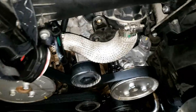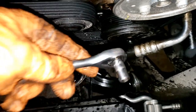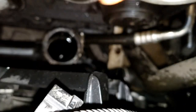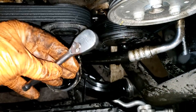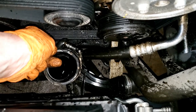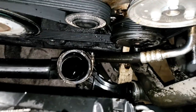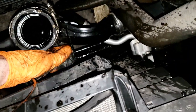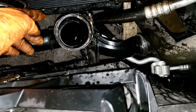I finally got this thing figured out. You do want to go ahead and disconnect it - don't try to get it all in one unit. I grabbed a 9/32 wrench, stuck it there, loosened it up, and I was able to get that one. Now it actually gives plenty of access to this bolt down here. I got it without this removed and it was a pain, so don't even waste your time with that - just get this one first.